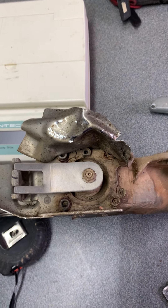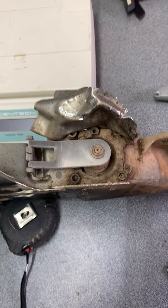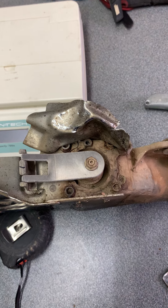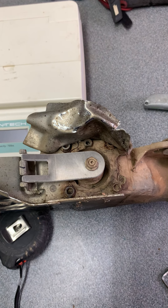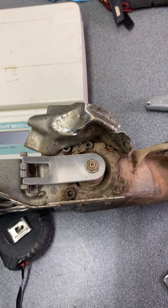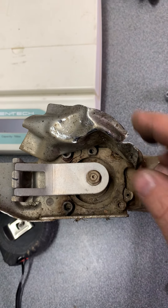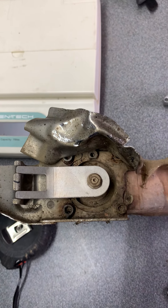You want to leave your servo motor attached to the sled and leave that plugged in. If you remove that or disconnect it, you're going to get an error code on the dash. But it's a pretty straightforward installation. Like I said, your biggest battle is probably going to be dealing with this cover if your bolts are corroded and stripped out.